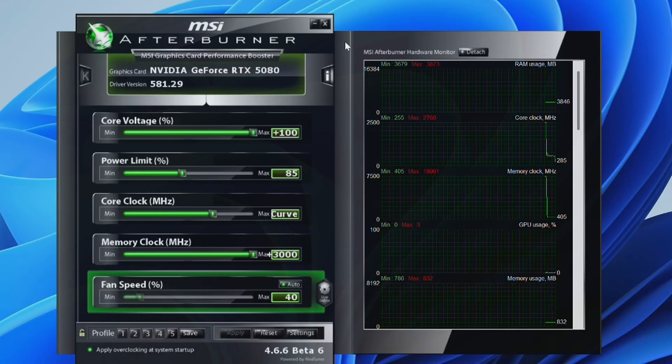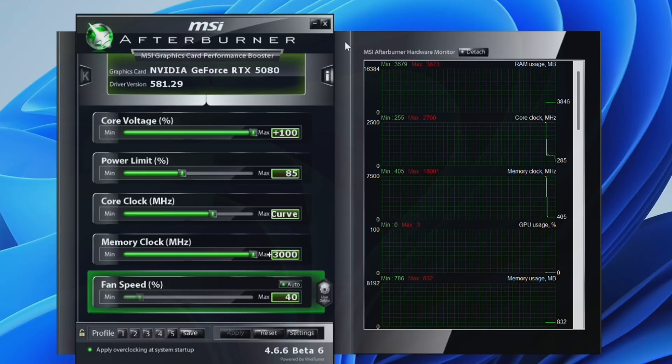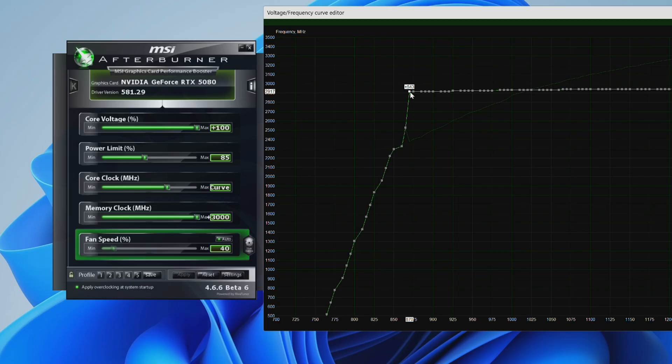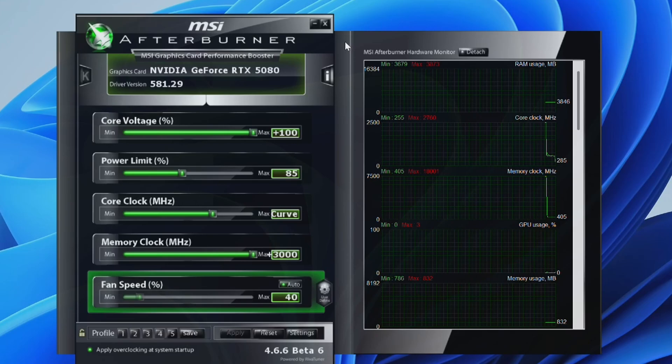To undervolt and power limit my card, I used MSI Afterburner. What I'm going to show you here is just my configuration and how I set up my frequency voltage curve. If you're interested in learning more about making these adjustments and don't know where to begin, I recommend checking out a mini tutorial I did with the RTX 5070 Ti. For my RTX 5080 Expert, I lowered the power limit down to 85%, targeted the point at 870 millivolts, raised it to 2917 megahertz, and combined this with a memory overclock using the latest Afterburner beta — raising the memory slider all the way to 3000 — which helps maintain performance close to stock or even beat it in memory bandwidth sensitive titles, even though we'd more often be maintaining a lower boost frequency than stock.